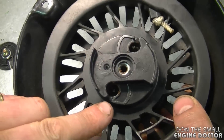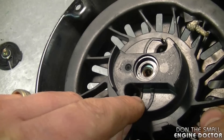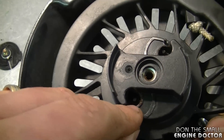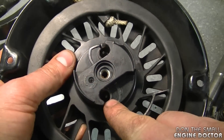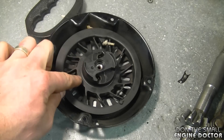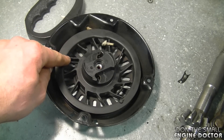At this point you want to examine the pulley and make sure that the little pins here, which are made of plastic, are intact — just as you see here on each side where the pawls go in. If these plastic pins are broken you will need to replace the whole pulley. Also, if the spring is broken inside and the rope will not recoil itself, you will need to replace the whole pulley as well.